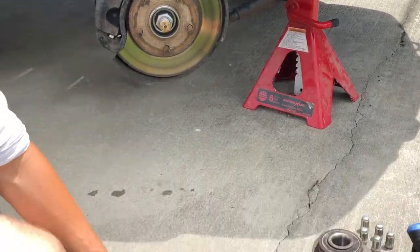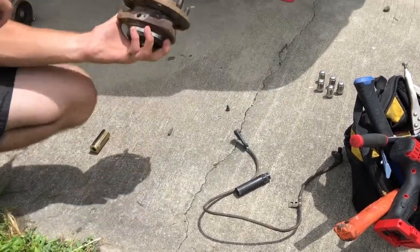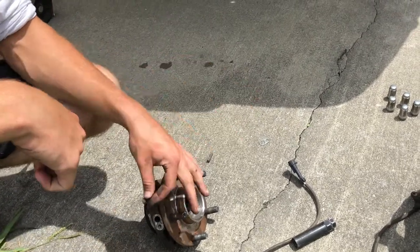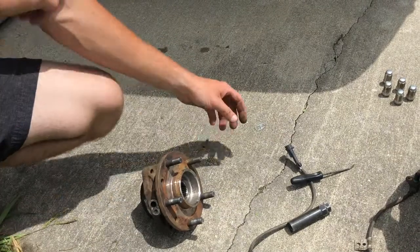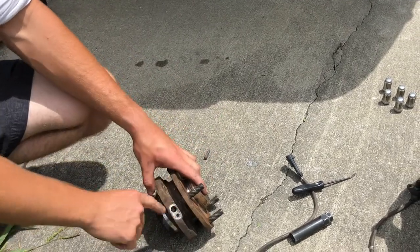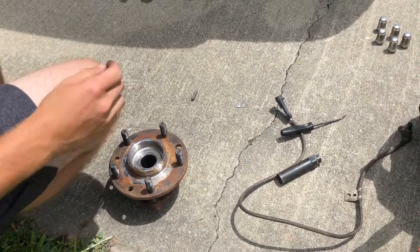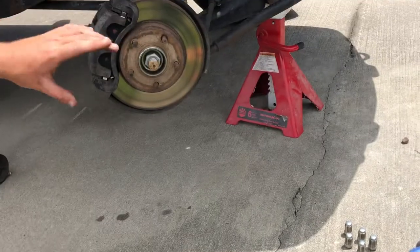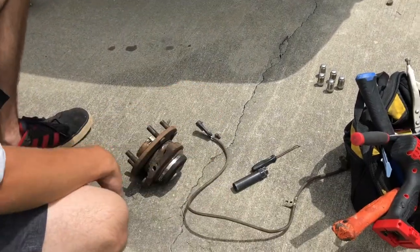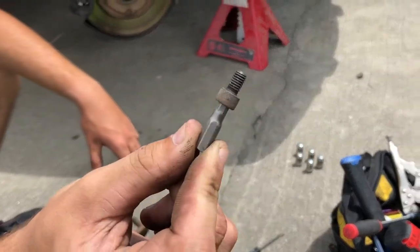The basic supplies you're going to need: obviously your wheel speed sensor, a new one or at least a donor. A pick to get any mud out — this is my S10's 4WD so I use it off-road, and the bolt attached to the hub may have dirt in it. You'll also need the little washer/gasket piece that goes onto the hub. To get the sensor bolt off, you will need an H5 hex bit.